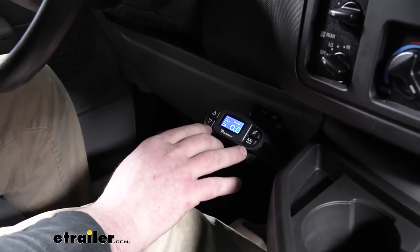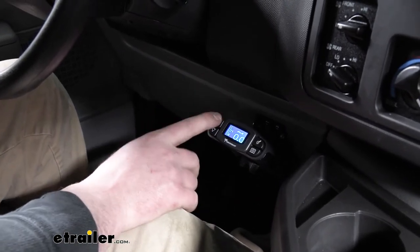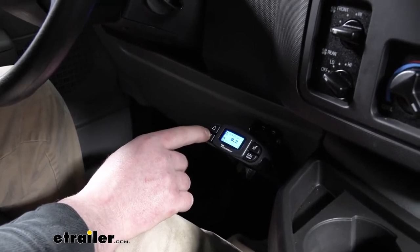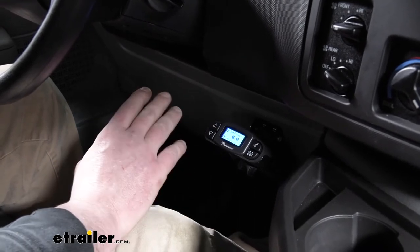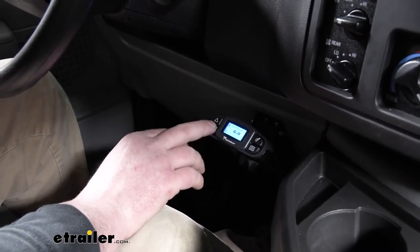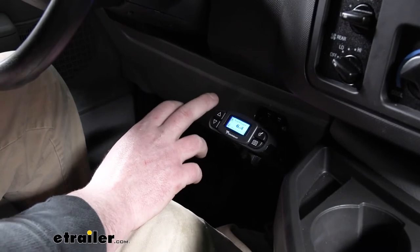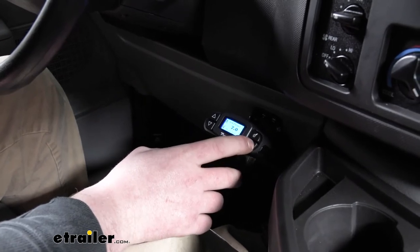We are going to have a lot of different settings and adjustability. On the left side we're going to have a couple of arrows, and if you push it, that's going to set the power or the maximum output. A good rule of thumb is to go down to about the middle — say six. You would take your vehicle for a spin with the trailer and apply the brakes. If the brakes lock up, turn that power output down. If they didn't apply sufficiently, simply turn that power up. So usually about in the middle is a good rule of thumb, and we'll put it at seven.